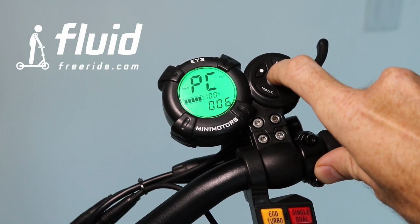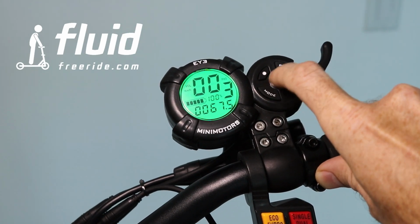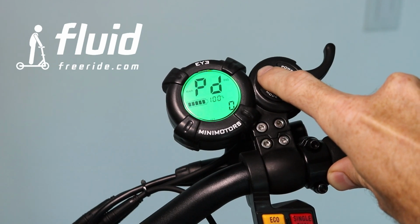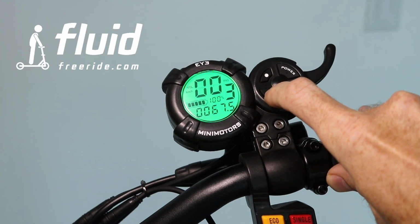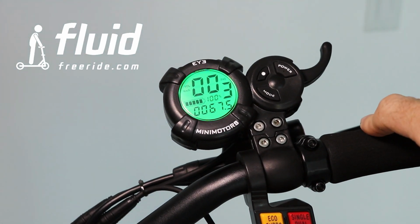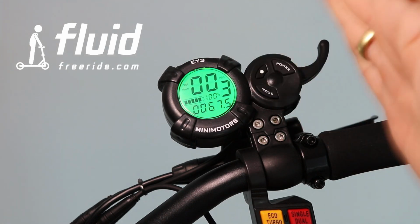And then PD is the last one, which is the anti-lock braking system, ABS. So talking a little bit about ABS, you can turn this on and off. So let's quickly see how that works. This is ABS on, this is ABS off. This is not an automatic blocking system like you know from a car, which means if it's on, it will always be on. That means you're riding fast, ABS is on, you jam on the brakes, and ultimately, independent of whether your wheel would skid, you still feel how the brakes are doing brake, no brake, brake, no brake within seconds, very quickly like this.